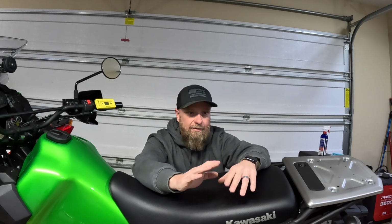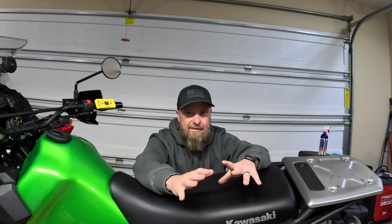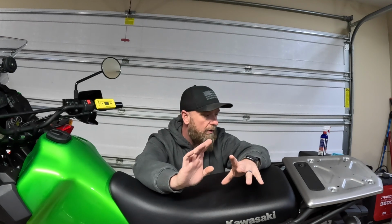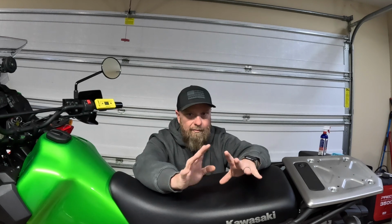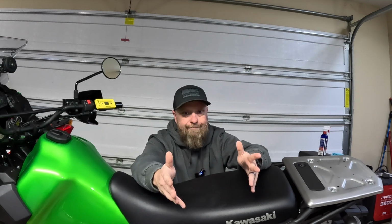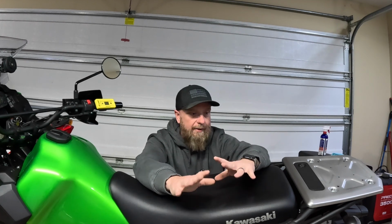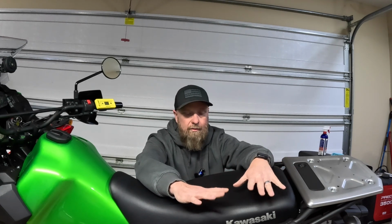On this bike it's set at 2, it's like 1 through 5. It's set on 2 from the factory. So we have it set on, I think we went up to 4, it was pretty good. Still a little bouncy, but 3 just up. I think it took 2 clicks to get there, and I'm going to live with that. I'm happy with it. The bike still rides good with just me on it, and we're overcoming some of the additional weight with the sag, so I'm very happy with it.